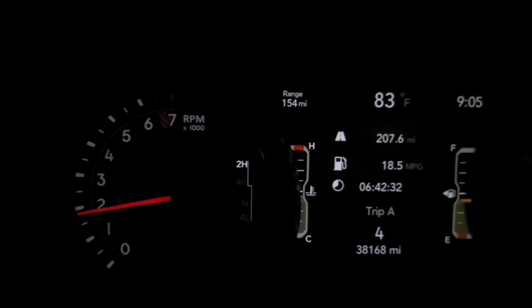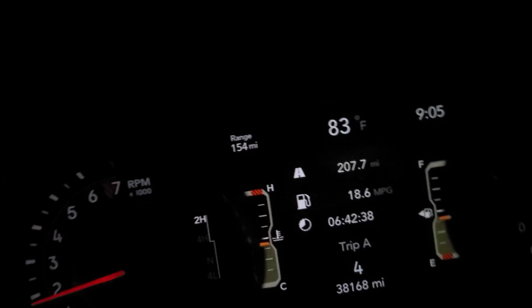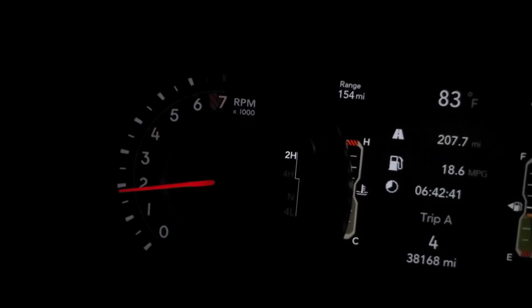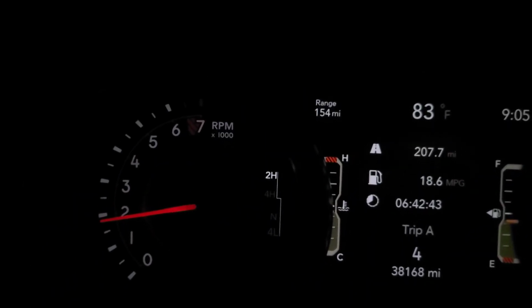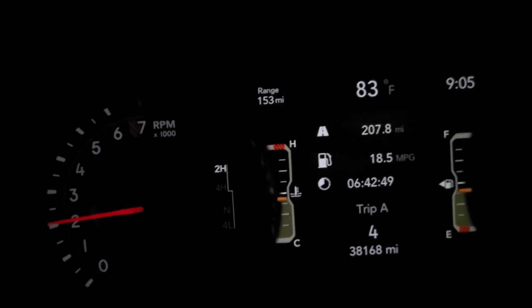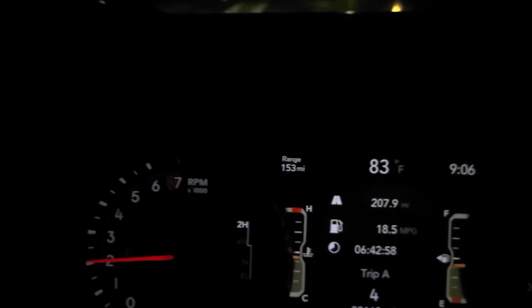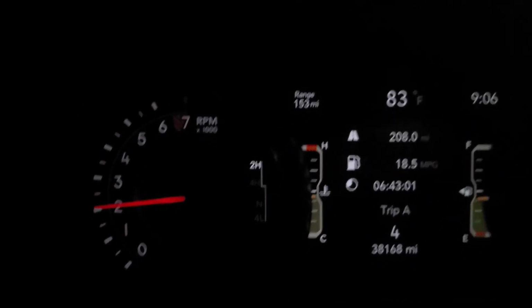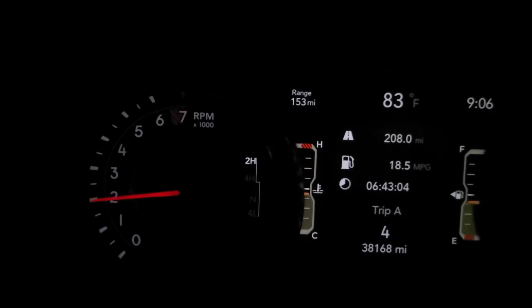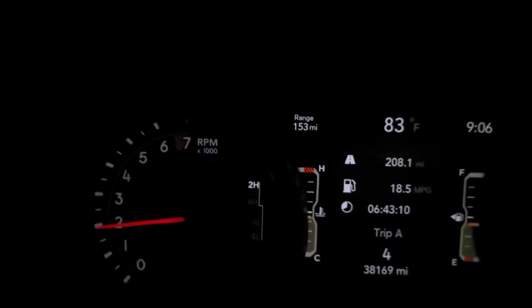Okay, first impressions. I'm in fourth gear, going, how fast am I going? 42. And this is kind of the dead spot in the RPM range. Pretty low torque, right around here. So when I accelerate here, I get a feeling I didn't have before, which is like that little dead spot is not as deep as it was before. I don't know how to better put it, but there's a little bit more of a reaction in that mid torque range, that 2000 RPM, 2500 RPM.